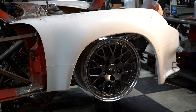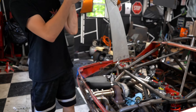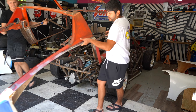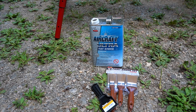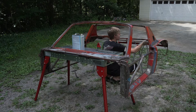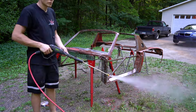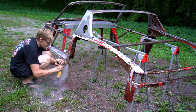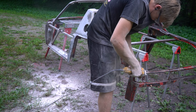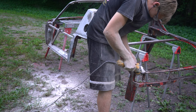With the spacers now measured up, I can send these rims off to the tire shop to get mounted. While I'm waiting on parts, I'm doing something I've been putting off for a long time — stripping the body of what's left of paint, bondo, and rust. To deal with the paint I got Aircraft Paint Stripper. This stuff is super hazardous, so make sure you wear gloves, a mask, and proper PPE. I brushed it on liberally and it works shockingly well — the paint can just be scraped or pressure washed off. Unfortunately stripper won't touch bondo, so it's removed mechanically with a wire wheel. Whoever had this car before me did crimes against humanity with bondo. But thankfully, that's as far as I have to go, so now it goes to the sandblaster and gets all the rust blasted out of the corners.